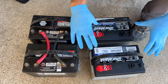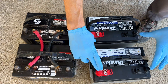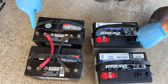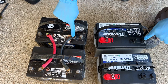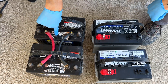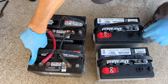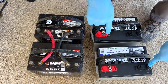You can picture this setup here would be just like the linear one. We would connect positive to positive, negative to negative. Then we would have another set of wires — a little bit longer — so we can come positive to positive, hook to these ones, and from negative around to negative, hook to those ones. So this is your first battery, second battery, third battery, fourth battery in line. We'll take our positive from the RV to our first battery, and our negative from the RV to our last battery, so the whole system is used evenly.